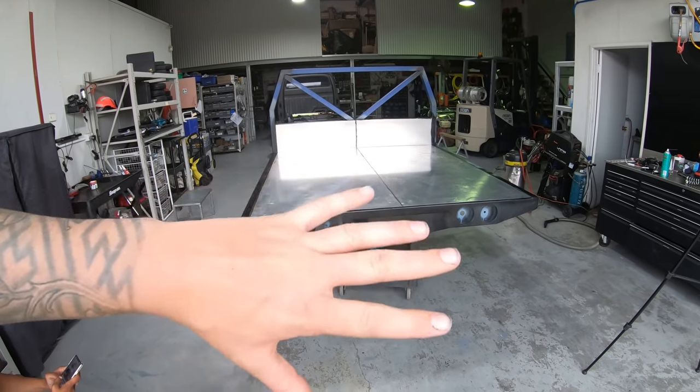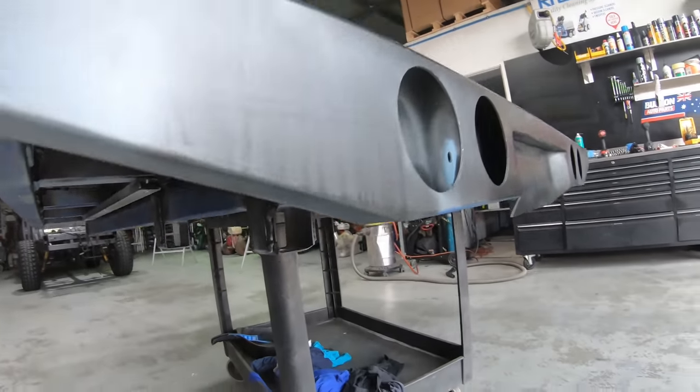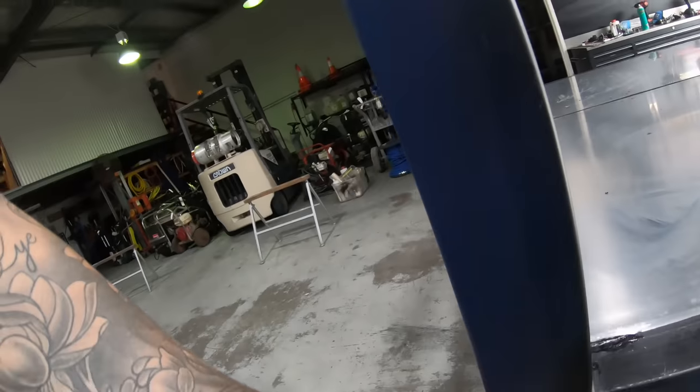Yeah, anyway, we've corked all underneath, all the steel bits, so you can see the blobs of silicone, all underneath's been done. And then we just went through it and put drain holes, so you can see that one in there. There's one under here, one about here, and a big 10 mil one here.